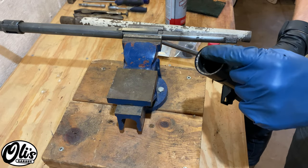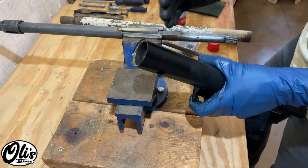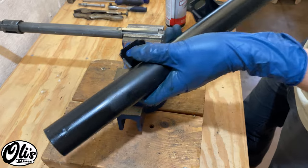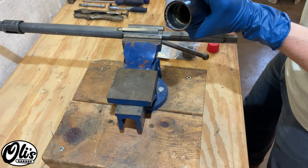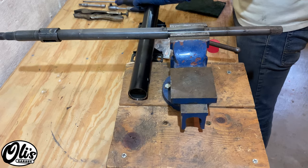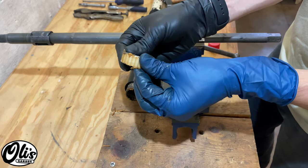I almost forgot — I still have to press out this inner bearing race right here. For most of you this will probably already be disintegrated, but if not you need to find a long piece of wood or metal that you can stick inside and press it out. I looked around and I found the handle to my jack to actually be the perfect size — it just fits inside and is able to press this bearing out perfectly, just a couple of love taps from a hammer. You can see how brittle this was and how it's already starting to crack apart into a thousand little pieces.